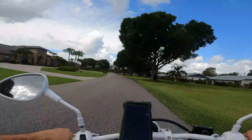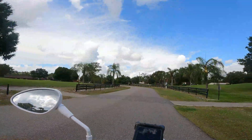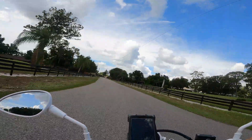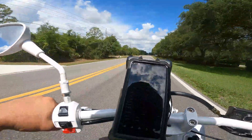Even though I've got the big variator, the three-gram roller still makes it feel pretty quick — still hitting like 9,000 RPM immediately. So it may not have changed anything. Those three-gram rollers may not be heavy enough to even push that variator out and get that belt up on top of it. Now there's 9,500 RPM already.